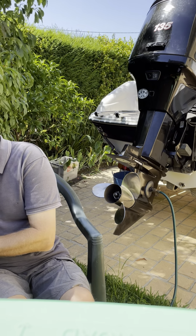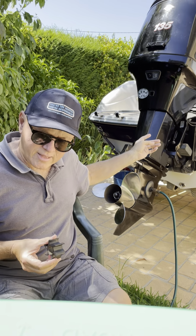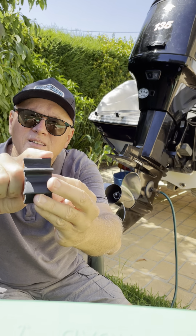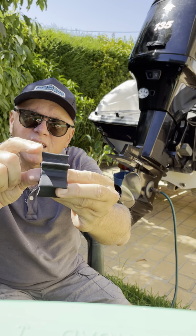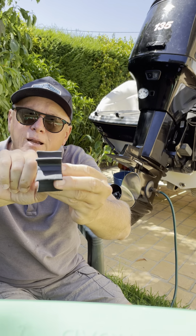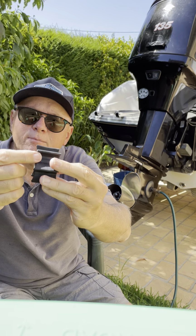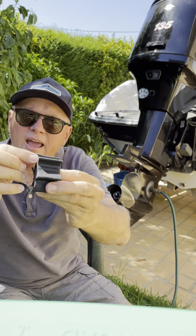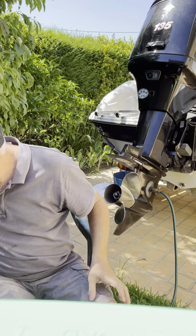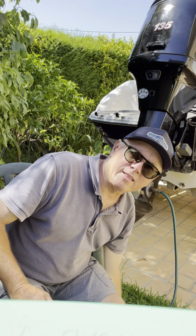And what you can see on this one a little bit, and I don't know how well you can see it, this one, I used that method of the hose connection on the back of the engine. Can you see that the bottom of the vanes are slightly swollen compared to the top, and they're all the same? What's happened, I think, is that when it's been run on the trailer, the water's been fine at the top of the impeller, but the impeller's forced all the water up to the top of the engine, and so the bottom part of these vanes hasn't had the same cooling, and so they've started to expand and swell. For that reason, I would say use the earmuffs. Don't use the hose connection on the engine. It's only a small thing, but it just helps your impeller last longer, and I really recommend that.